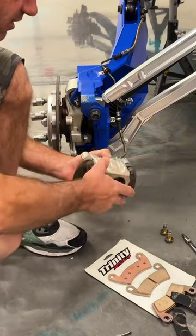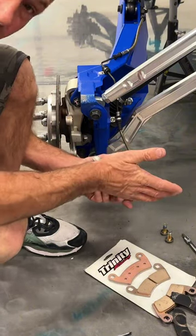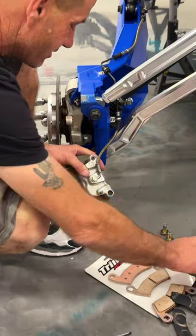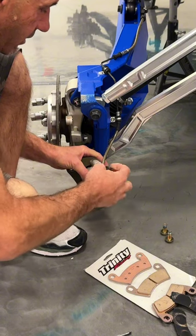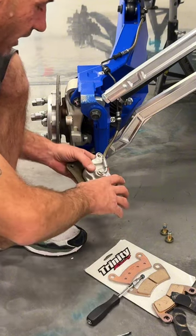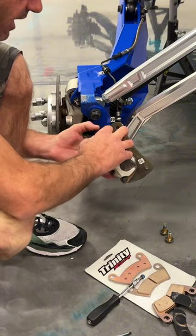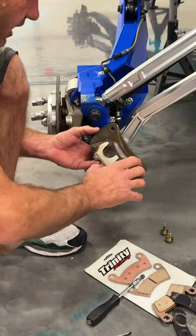We're going to pull the pads off. Now, you can see on the Pro R, there's actually a bolt in here now. On all the other models out there, right here is a set screw, but it's an Allen head. It's an H5. So if you don't have a Pro R and you're working on your XP or something else, you're going to pull that out. And then when you depress right here, the pad actually pops out, rotates over, and you take it off, and you do the same for the other.